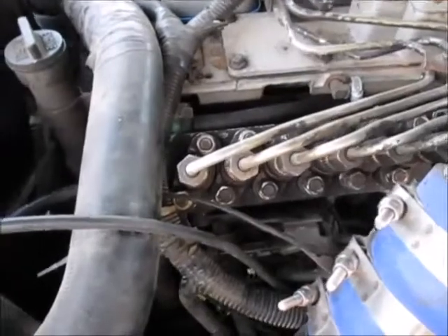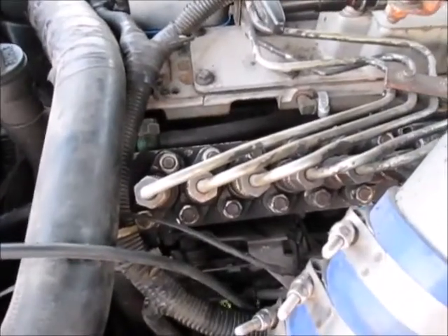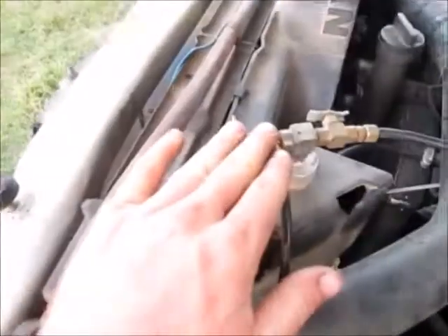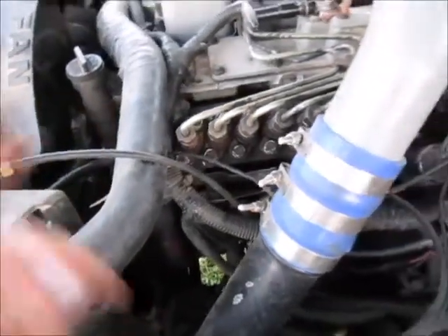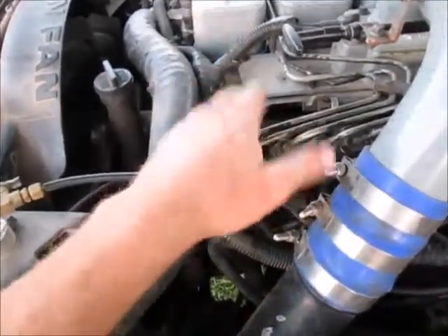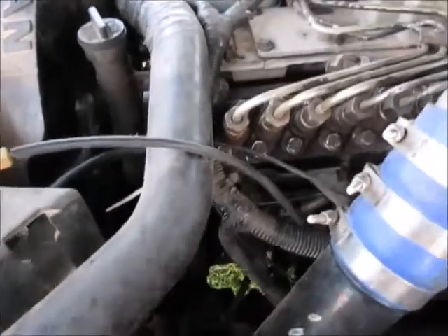You really don't need exactly 10 psi — there's nothing scientific about it. You just want plenty of pressure without opening the overflow valve, because once you open it you just dump air into the tank. Also, if you have a system where you don't have to remove the inlet fitting from the pump, you'll want to crank up the pressure to about 30 pounds and let the air push the fuel in the injector pump back out to the tank. Otherwise, when you open up the delivery valve port, it's going to shoot fuel at the hood.